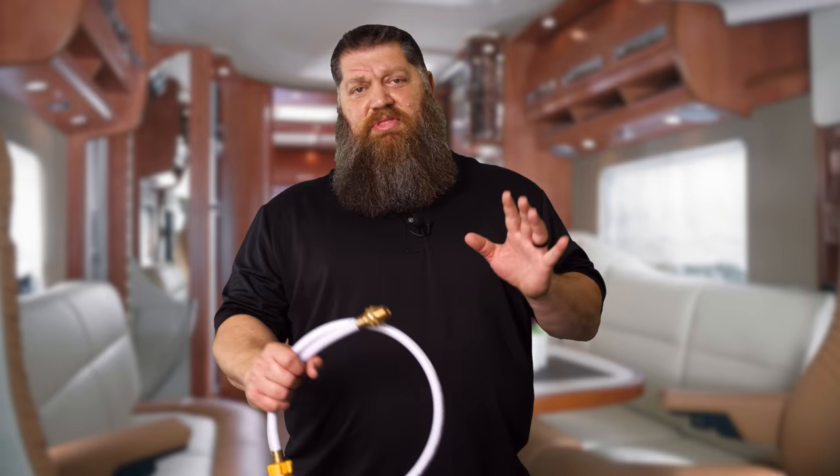The first installment to summerizing your rig — and yes, I'm holding the hose — is: if you have actually stored it for a couple months or a couple weeks or so, this is a good time to go ahead and start sanitizing your water systems. Now in this video, because it's only two minutes long, let's tackle the water heater. I know a lot of you will go out and buy that little wand because you want to clean the inside of that water heater.